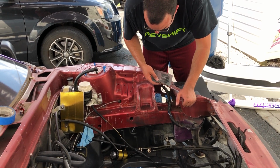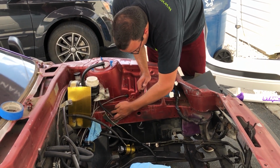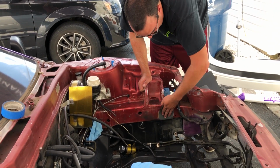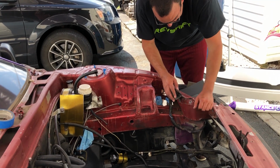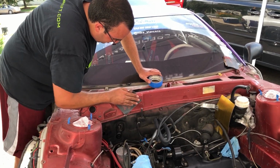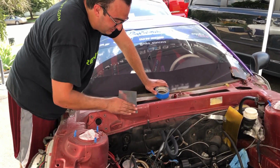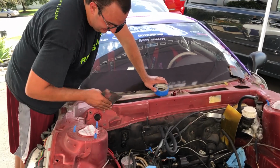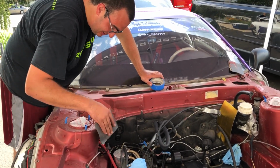Oof, that's a big oof, brother. Gotta brake clean that real quick. I'll hit it with some Purple Power, a little power washing. Just smear all that grease right into the sandpaper. She's toast. This is the first time Mike has ever prepped anything. Those rattle can jobs are all about the prep, man. All about scuff and clean paint. That's how you get those long-term rattle can jobs.